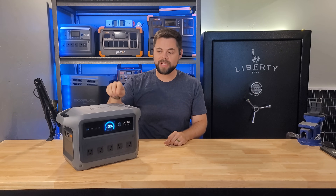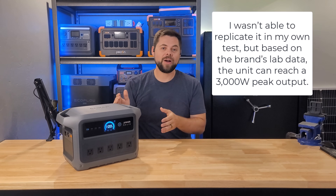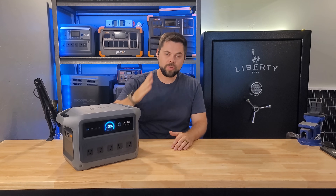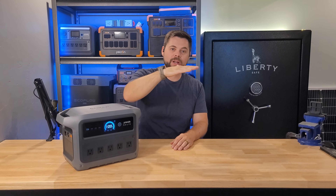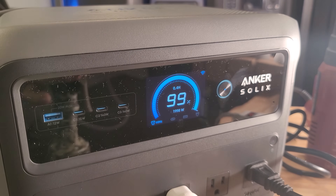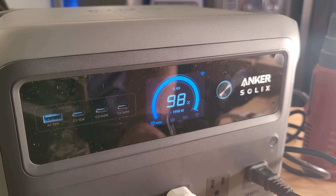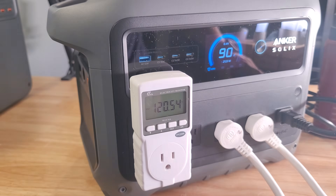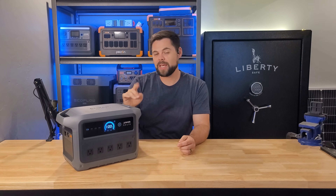This is my full and honest opinion of the C1000 Gen2, which has some major differences from the C1000 Gen1. One thing I found a little weird with the inverter is that it does have a 2,000 watt inverter, but I could not find anywhere what the peak output is. When you turn on something like a sump pump or water pump, you have a huge surge of energy at startup before it runs at its continuous rate. Customer service didn't know the peak surge figure, and it wasn't in the user manual, so that part was a little weird.